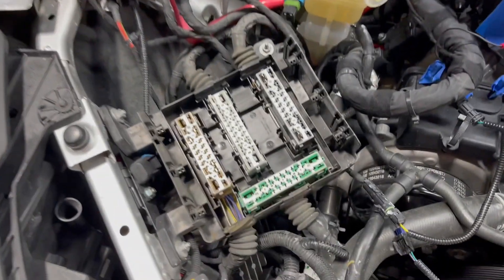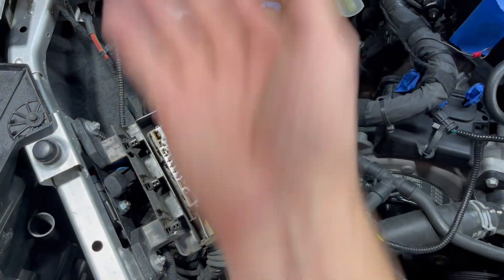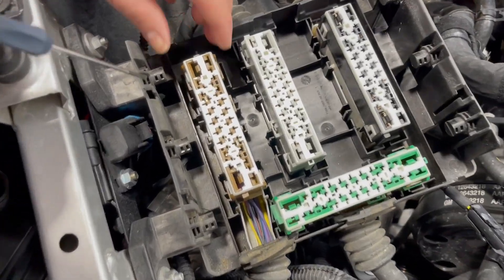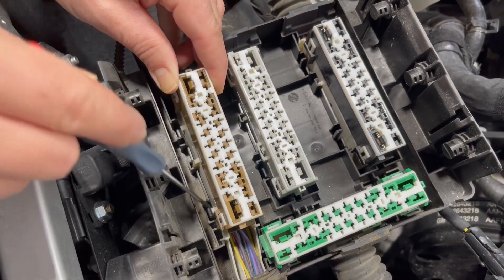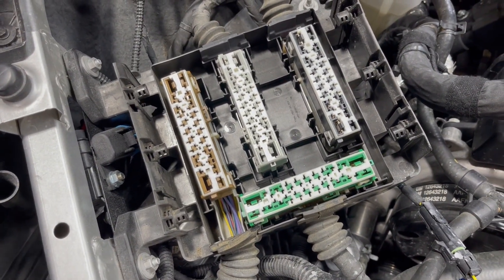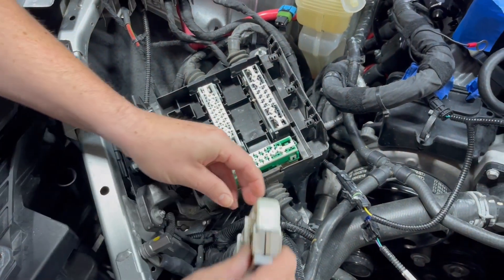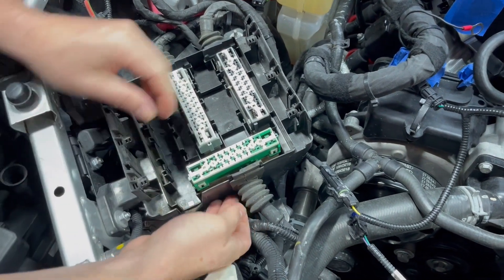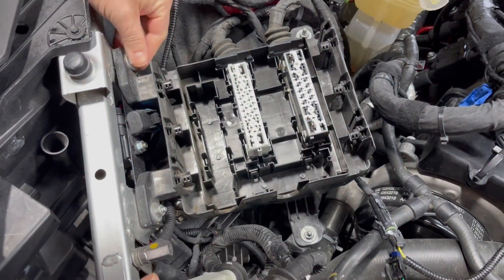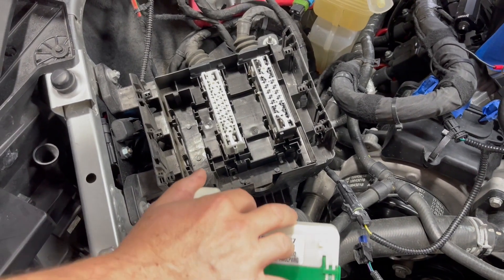Now we get the fuse box tied up out of the way. The next thing we need to pull out is this connector and this connector. By removing these out of the box, this box will also flip up out of the way for us to achieve access to the ECU. On these connectors there will be four points that you have to release — they're kind of light pulls and you just need a small screwdriver and a little bit of help sometimes. Once you get them all released, this connector will just lift out. We're only going to remove two of them. That frees us up to be able to unbolt the box.